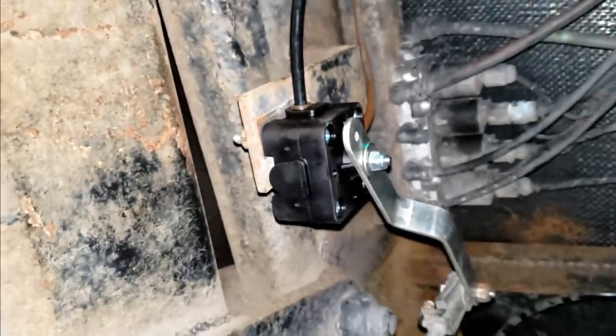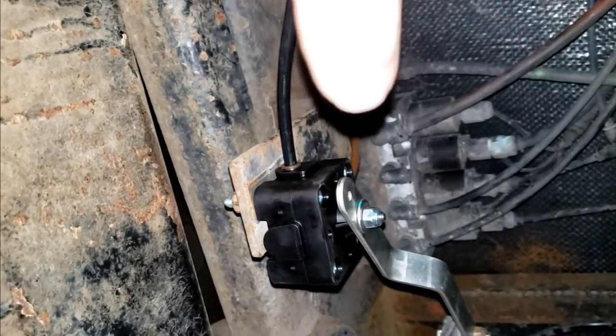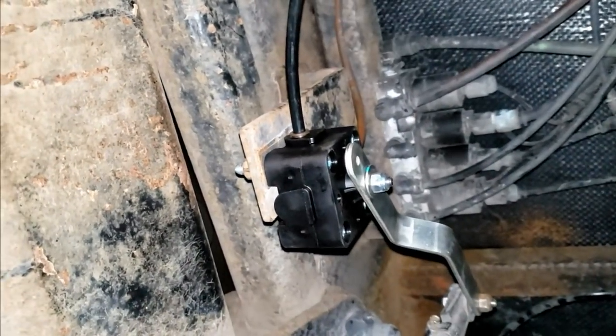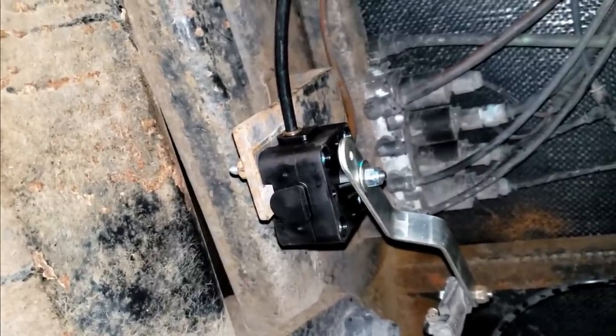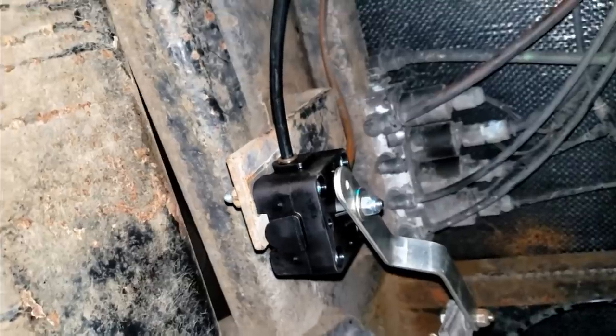I've repositioned the supply line to every port available on this valve and it doesn't seem to affect anything. So I think we either have the wrong valve because it doesn't look right, or it's broken. It's after seven now in Arkansas, so I'll have to put that zip tie back on to kink that one line so we're not losing air out of the airbags. That's why it was maxing out — because it couldn't exhaust any air. I think it's all starting to come together now. It's confusing, but that's how you work a problem.